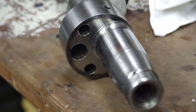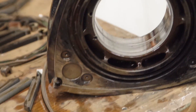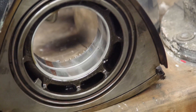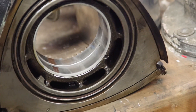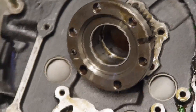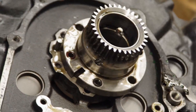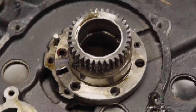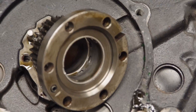An interesting thing is that the bearings inside the rotors have got roll pins in them to pin them in place so they don't spin. Usually they're just a friction fit on later engines, but I think Mazda actually did this from the factory on the earlier 10A's and 12A's which ran the twin distributors. The stationary gear has also been drilled and tapped with a pin that holds the bearing in place to stop that from rotating. This is actually an FD RX-7 - a 13B turbo stationary gear - that has been machined down so that the teeth match the length of the original 10A stationary gear.